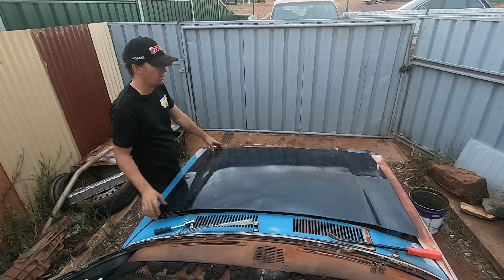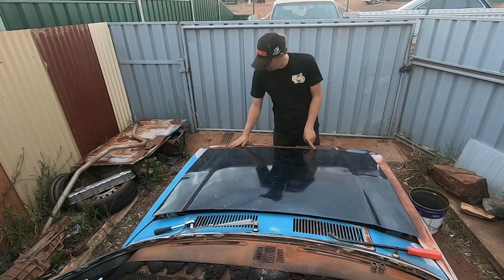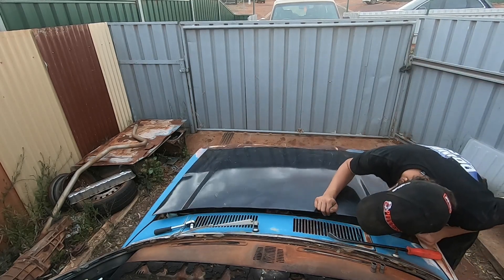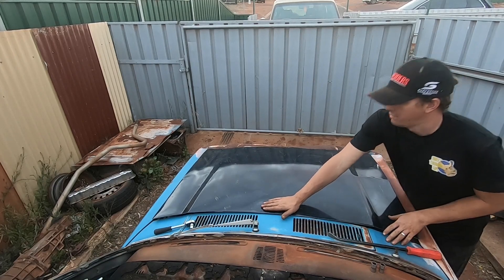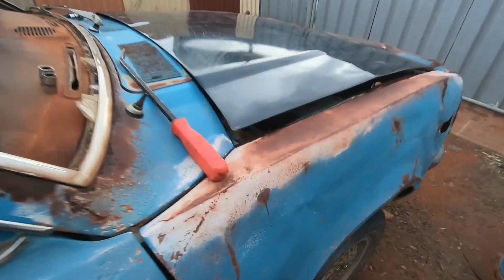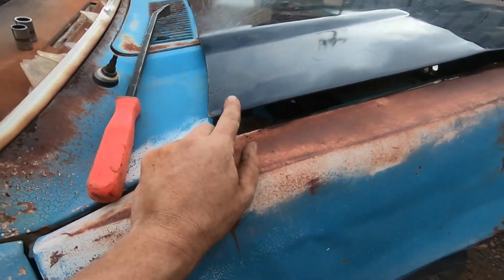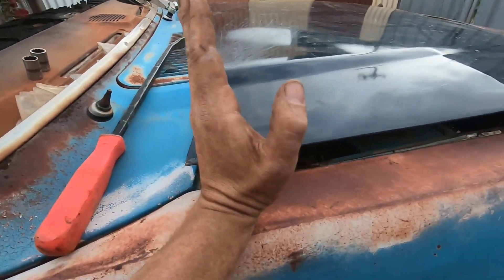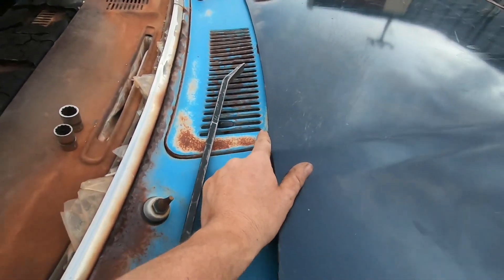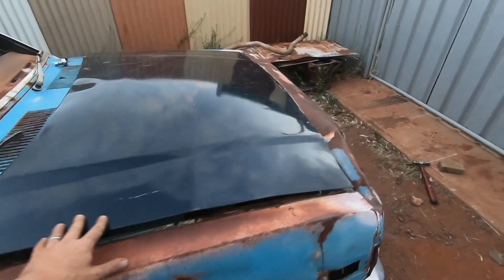It's scraping. Man, it is so out of whack along here — it's incredible. That's as good as it's going to get. Talk about panel gap — that's pretty mighty now. What's happened is the latch on the actual bonnet is bent, forcing the bonnet to overhang onto the cowl ever so slightly. But for all intents and purposes, we just want to get a bonnet on it so that we have a complete panel.